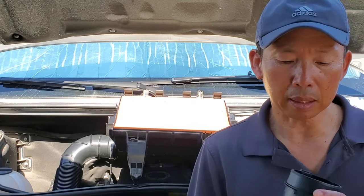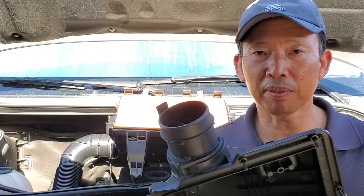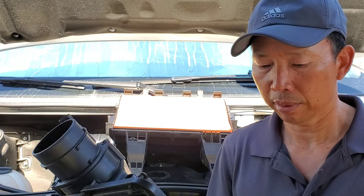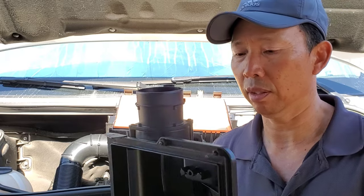That's all I wanted to talk about — just in case you're out there driving and all of a sudden you have that symptom where you try to accelerate, it doesn't go, it doesn't kick into the next gear at all, and your engine light comes on but you don't have a code reader — go ahead and try to clean this part out first, to start with. I'm going to put this back and go ahead and watch the following video I took when we were fixing it on the road. We took a road test and it worked right away — a simple fix, thankfully. We were way away from home. I hope this provides some clues and tips if you run into that kind of trouble with your Mercedes Sprinter.